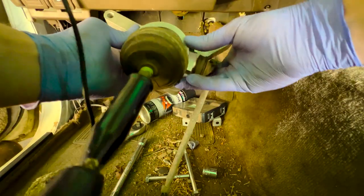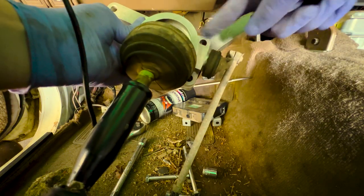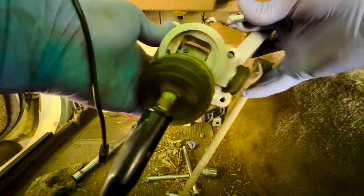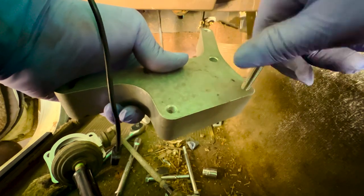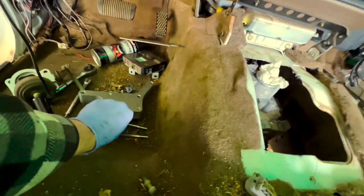This specially designed piece will go on top, and it's obviously connected to the lever which will connect to the transfer case. This fits just over the top of it like so. You'll thread the longer bolt through, which will go through the NV4500 along with these two. There are some shorter bolts because to get this in there, there are already machined threads in there. Anyway, that's how that's going to go. You're also going to want to get some stainless steel standoffs so you don't rust.